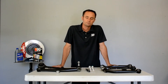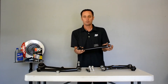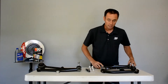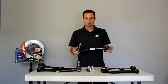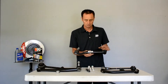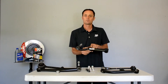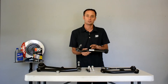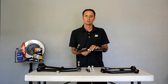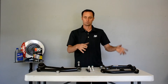The other thing we have is our control arm or lateral link. Here is a standard GT lateral link — you'll notice it has a rubber bushing, a standard ball joint, and no potentiometer mount in the center. Some of the newer Shelby GT350Rs or track pack cars have a rotary potentiometer to tell the chassis where it is in heave, roll, or whatever.